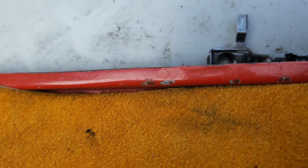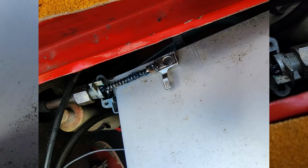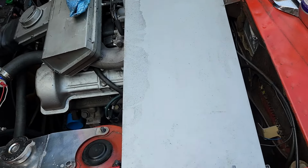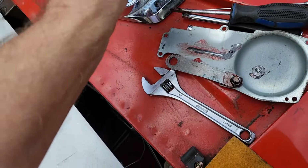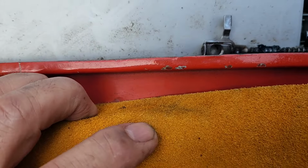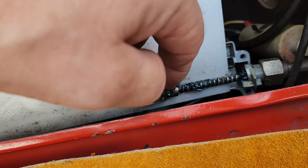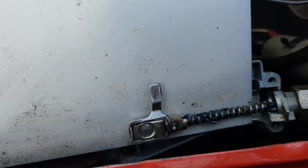And definitely why the wipers wouldn't park. So even if that weld fails, I mean, I just blipped it and used good old brake cleaner to clean it up so I could get a decent weld, and yeah, found out the hard way it's flammable. But yeah, managed to get that under control real quick, and it would have meant completely taking all the wiper mechanisms out and the dash to get this out. So if it fails again, I'll know what it is, and then I'm gonna try TIG welding it next time.